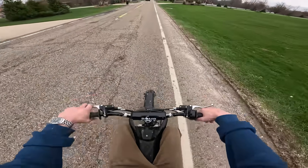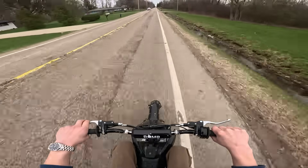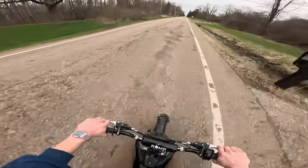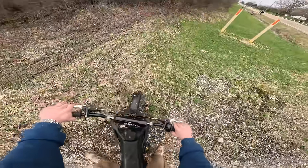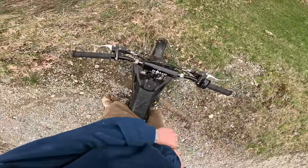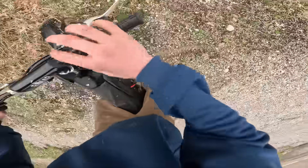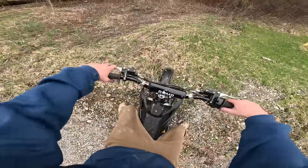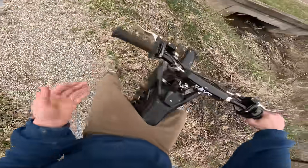This thing is fast - look at that. Let's see how fast that was: 54 mph right there. This thing does a comfortable 54 to 55 miles an hour - super nice speed. I am pushing this motor hard; I'm running 150 amps right now compared to the suggested 70 amps, but it's taking it fine. I'm only about 120 pounds though, so if you're a heavier person you probably can't run 150 amps - maybe around 100 without overheating, since this is just an MY1020 motor.